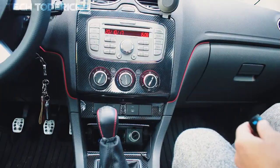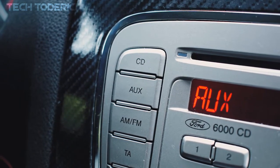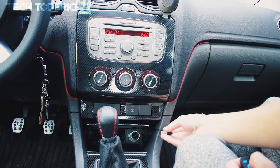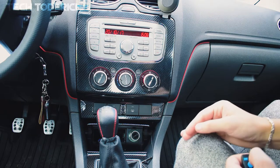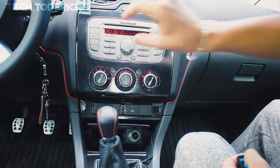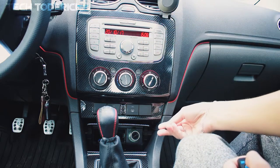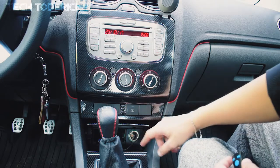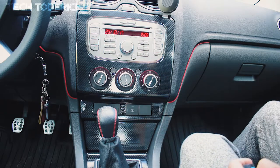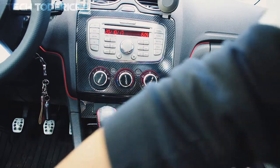Just a note there, because those noises can be creepy. First of all, you're going to need an AUX button on your radio system. If your radio has the AUX button but you don't have the cable — here's my cable. My radio system has the AUX button but didn't come with the cable, so I had to purchase the cable, take the radio out, install the AUX behind the radio, then I brought my AUX cable through this panel right here and hid it — I just placed it here and closed the tray.